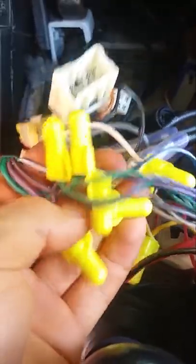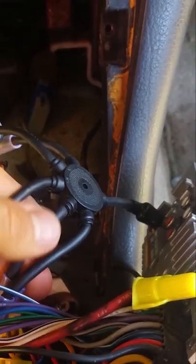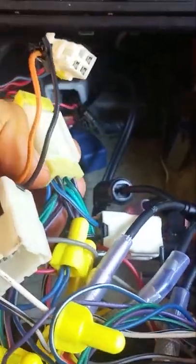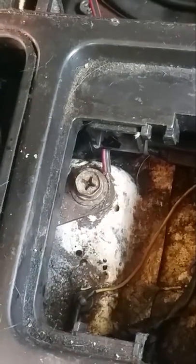You can see somebody used a bunch of wire nuts and wire nutted everything together — there's a lot of them, and this is the absolute worst way, so don't ever do this. You can see they got the little adapter here for the antenna with like five of them on it — you only need one. Then there are all of these plugs, some are necessary, some aren't even used. Then there's the ground right here, wire nutted of course, and it runs all the way back to that bolt right there — that super rusted bolt — and it's like speaker wire.